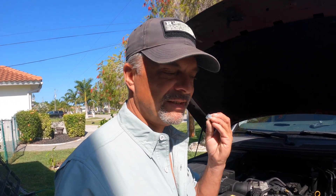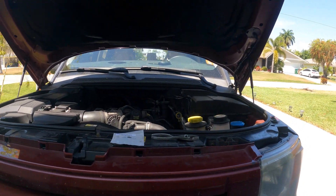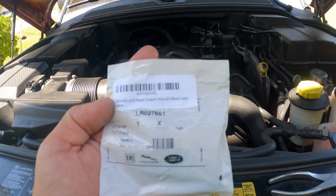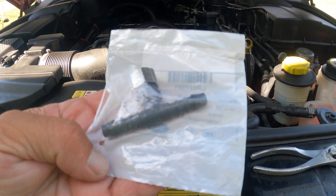What we did initially to fix it: we put in a small copper piece and put it back together, got the air out as best we could, put in new coolant, and that's how we hauled it home. The car runs really well — it just needs a new air valve to get the air out of the system properly. If you hear funny noises or get water coming out somewhere, just pull over. Don't risk it or you'll end up with blown head gaskets. Stay tuned — I just received the spare part this morning.